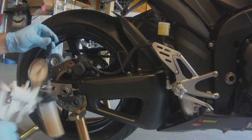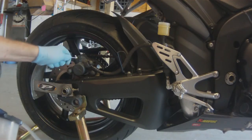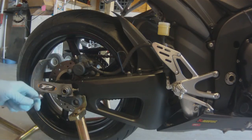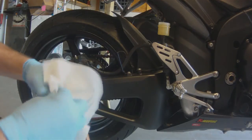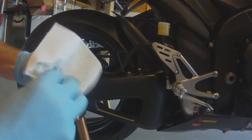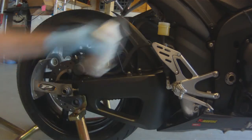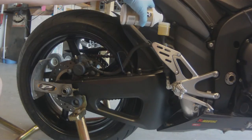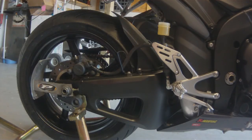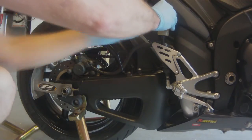After you've pulled at least two reservoirs through your brake lines, your brake system is flushed and you have new fluid in your entire system. Clean off any old fluid residue from the cap, top off the reservoir only to the full line — don't go beyond full — and put the cap on.